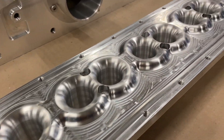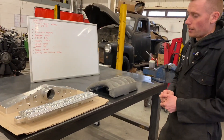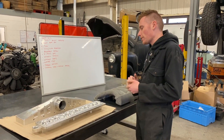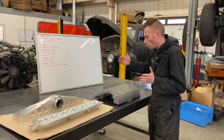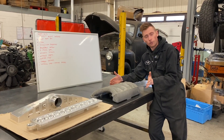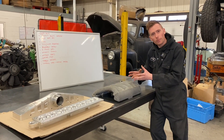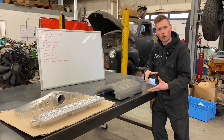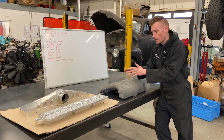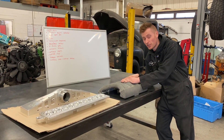The original manifold doesn't have any kind of velocity stacks inside — it's just holes inside the casting. We wanted to add that as a nice performance feature, and it looks absolutely stunning. Size and width reduction was a really big factor. One of the big problems with the 606 inlet manifold is it comes out a long, long way from the side of the engine and often causes problems in certain builds. Some people chop them down, modify the plenums, or put a larger plenum on for performance. Sadly, welding a fabricated plenum to original cast runners generally — and some people are going to get hurt by this — generally looks garbage.